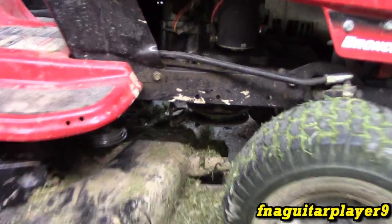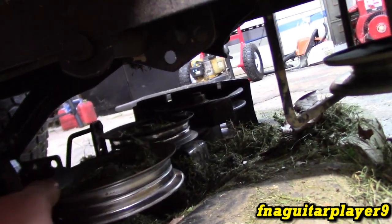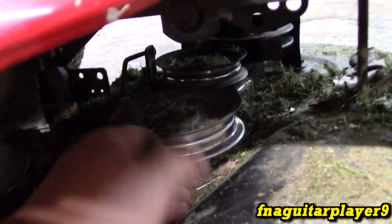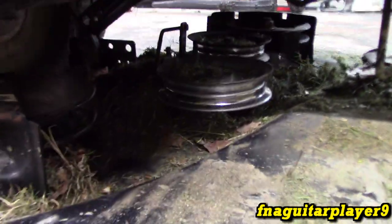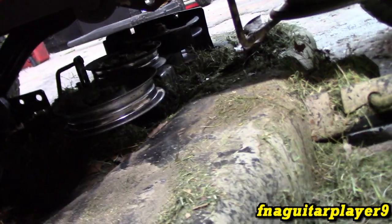It's also a good time to check your pulleys. This one is moving because the bracket has some play in it; the other one is good — I already checked it. This first pulley is the type that will move when you engage it, to put the tension onto the belt. Alright, let's just get started on the belt.